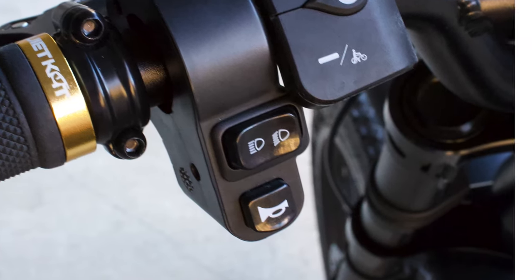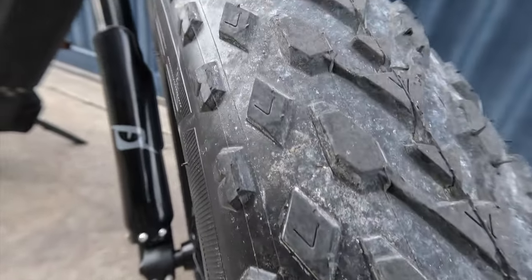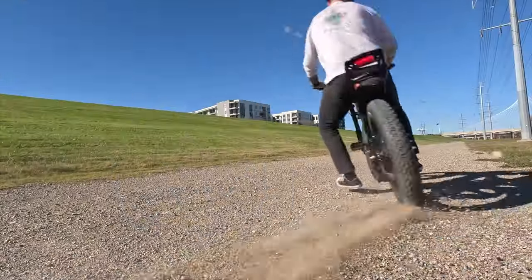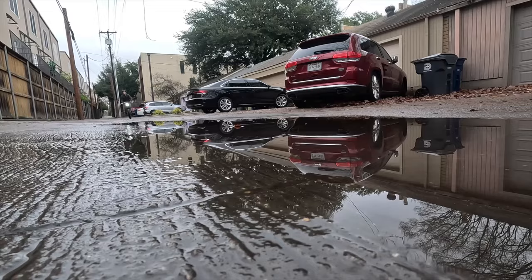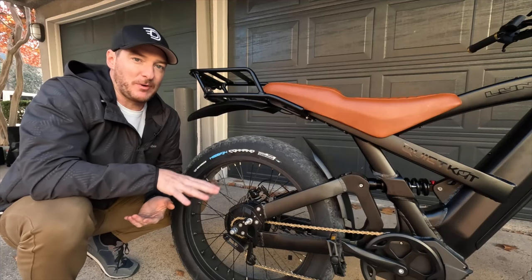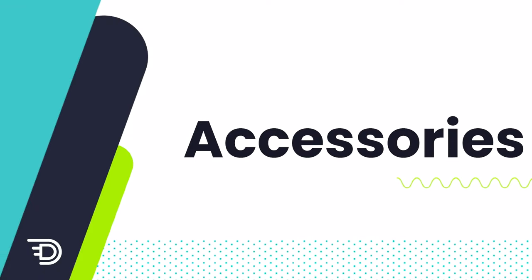The Lynx has 24-inch wheels — something a little different — with four-inch wide tires that are a good blend of urban and trail riding. The knobs are not too thick or too knobby, but they grip just right. The perk of four-inch wide tires is you can ride them at slightly lower pressures for better grip in slippery situations. On city streets, ride at higher pressure; in sandy or snowy conditions, lower that pressure and the tire acts like a snowshoe, distributing weight across the surface.